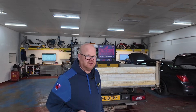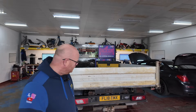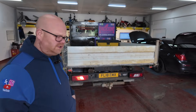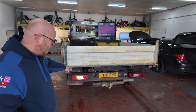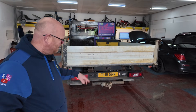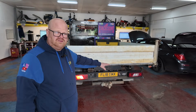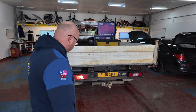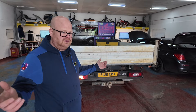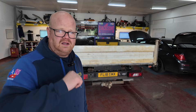Back again on the RMS channel. We have got a 2018 Transit doing no rear lights. We've got one reverse light and an indicator working. All the rear lights are on, we've checked the brake lights — they're not working. Apparently all he'd done was damage that rear light, it went out, and he's changed that cluster. He booked it in for just the one side, but no sides are working. He did say that side stopped when he banged it.